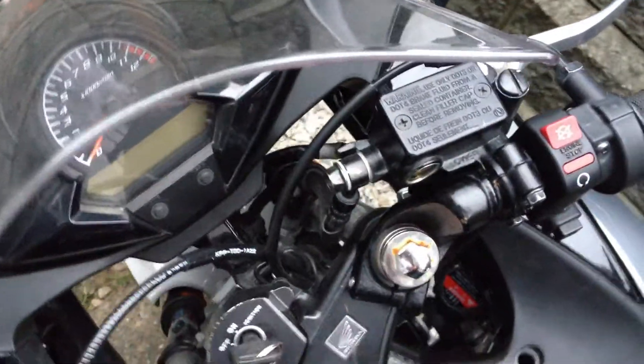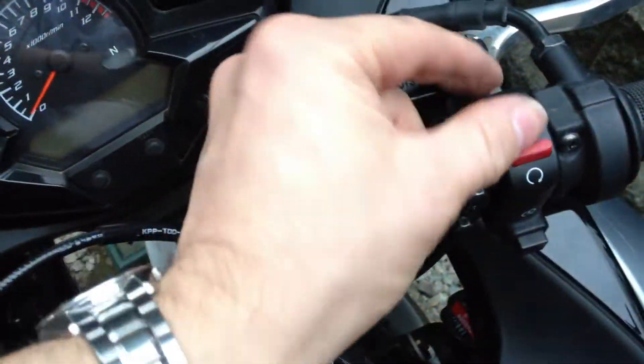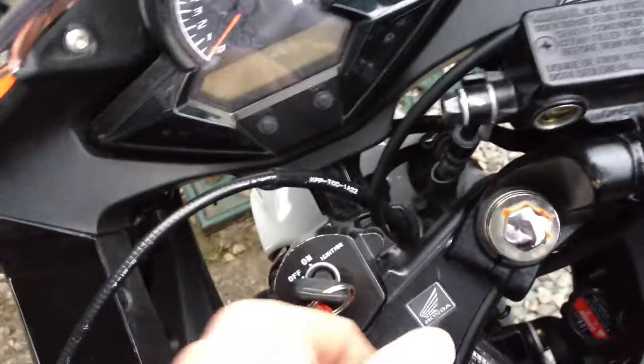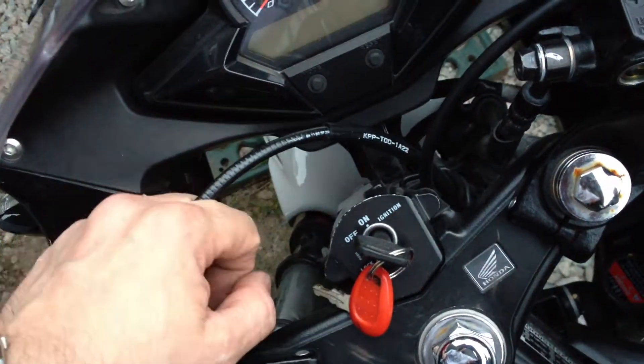When the bike seems to cool down, this is what happens: the kill switch is on and I'm going to turn the bike on. There should be a yellow light here on the dash, and this fuel pump here on the underside of the tank should be whirring and buzzing — but nothing. I turn that one on, I got lights, except this one is not whirring.